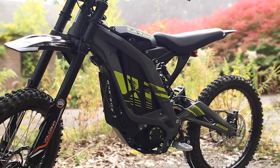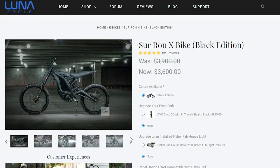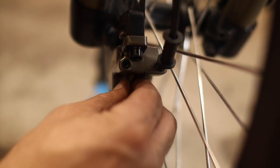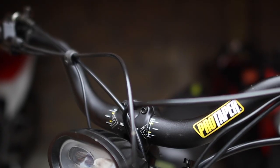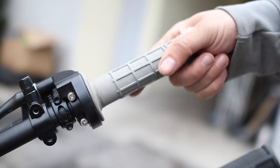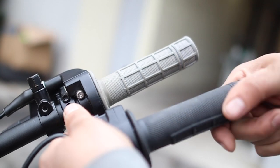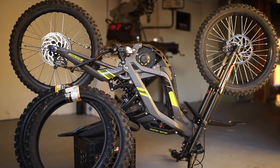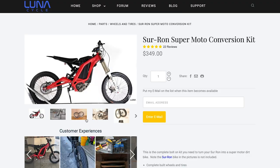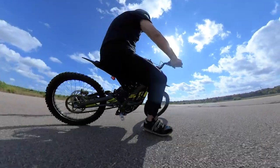For upgrades, the bike is easy to customize and there are plenty of options. When it ships from Luna Cycles, it's the matte gray frame that comes with green stickers that you can apply. We also recommend right away upgrading to the Shimano Saint brake pads — our stock pads were squeaking, and we noticed an improvement in brake fade and stopping power with the Shimano. We also upgraded to 3-inch aluminum Pro Taper handlebars, which really improved handling and comfortability on the trails. The Suron features a cable throttle which does the trick, but we noticed it's starting to stick, so we upgraded ours to a quarter-turn electric throttle from Magura. We also replaced our tires to Dunlop Geomax MX33 tires. There are plenty of other mods out there for the Suron, including larger battery upgrades, super-moto street wheels, or swapping out the chain with a belt. We'll leave links in the description of the video to all the different upgrades we showed and others.